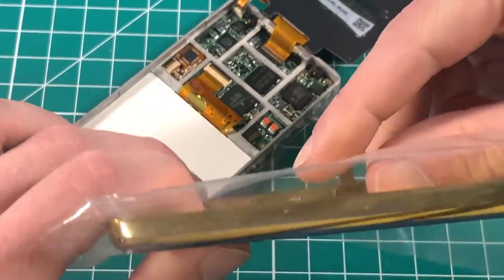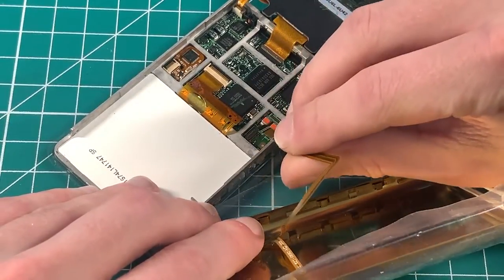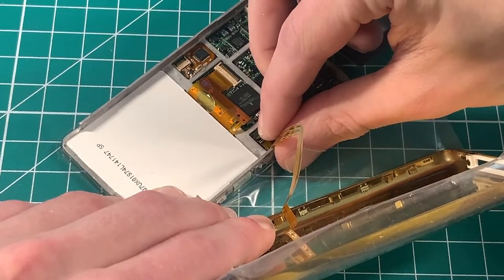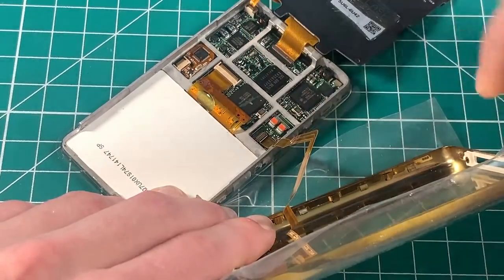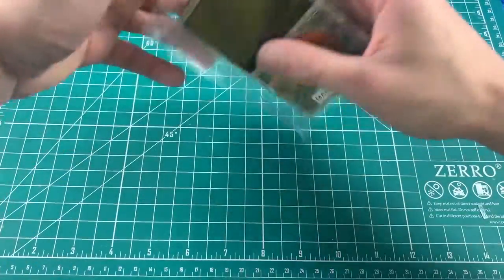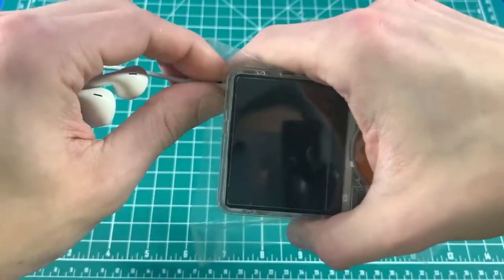To insert the backplate and headphone jack, get a hold of the flex and flip up that motherboard ZIF connector, then latch it back down. Check the lock hold switch, and finally the headphone jack — you always want to wiggle it a little bit just to make sure.